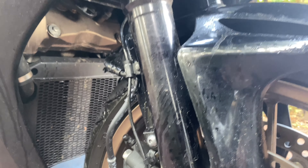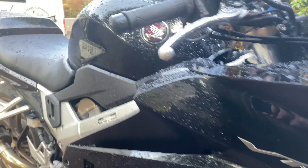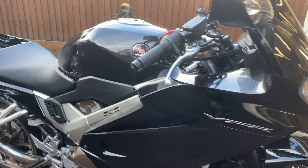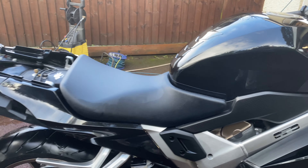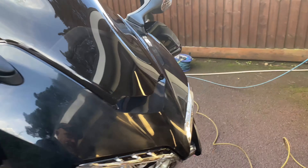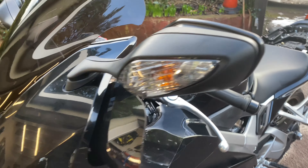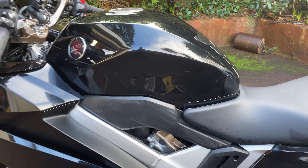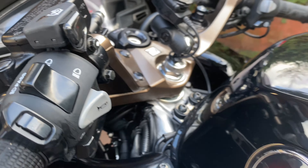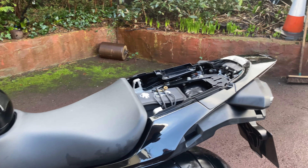The client said it was really clean before he went out, only got caught in the rain once — that's all it takes. Anyhow, let's get cracking. First stage is done — I've done the three-step wash on this. I pre-rinsed it, then snow foamed it, rinsed it again, degreased it, and then washed all the bodywork. Then gave it a good rinsing. I then blow dried it, getting all the moisture out of all the switch gear, suspension linkages, all the wiring — everything's been blow dried.